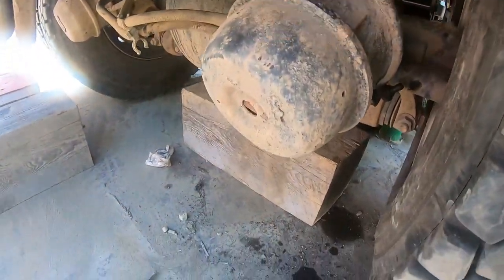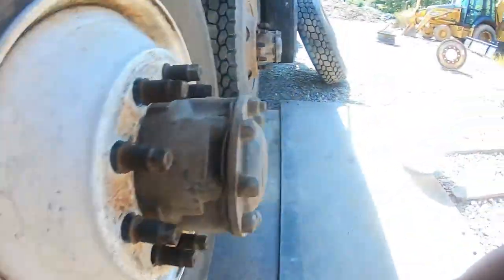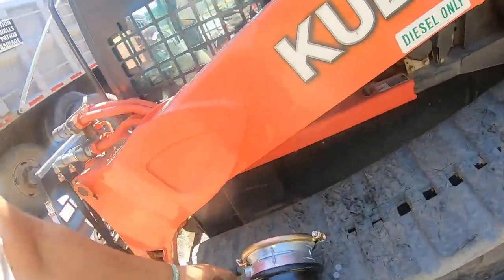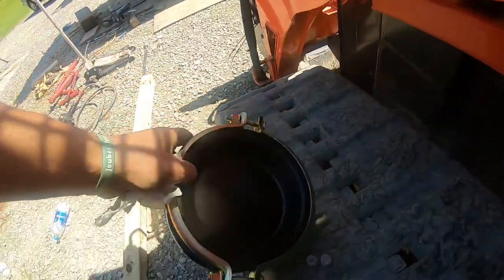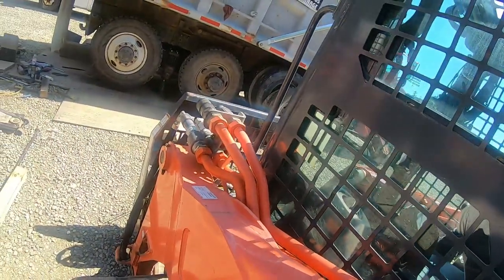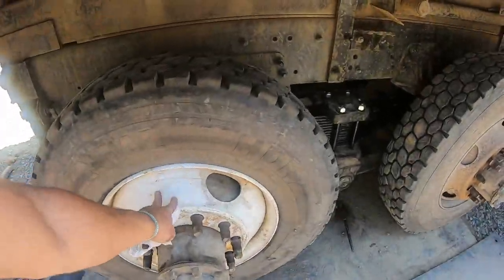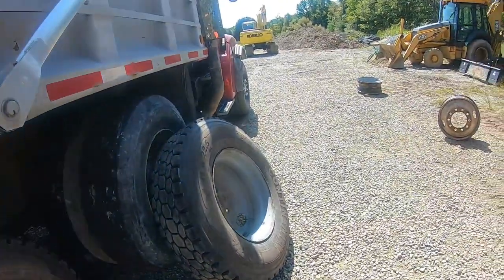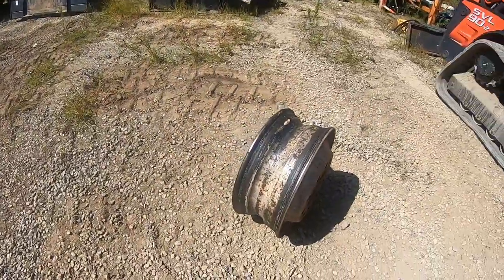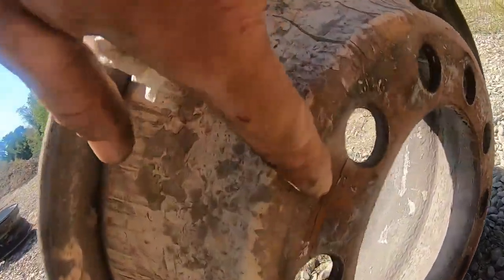The other thing he told me to replace was this can — the parking brake's not working on this side. I didn't get a violation for that because the brake still works but the parking brake doesn't. Got a new can to replace that. Everything else is done on the truck. Got new used rims — this was a cracked rim that DOT didn't find. I just replaced it; it was just a spider crack, just starting — that's the bad one right there.